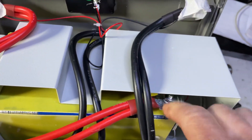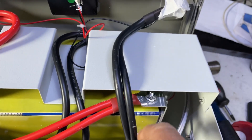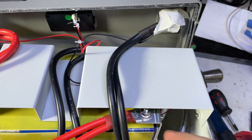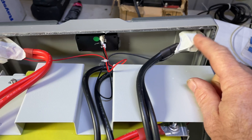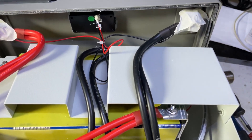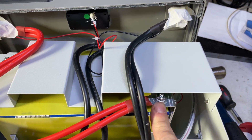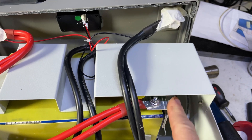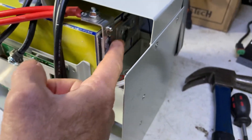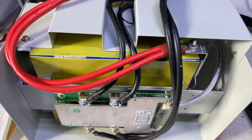The posts sit right underneath the cells, under this metal bracket, so you wouldn't want to drop it or push hard on top — it'll probably short out. Negatives are over here, positives there — that's pretty dodgy. There's masking tape used as insulation on the positive post, which is pretty rubbish. The negative cable is on a fair angle and was jammed hard against the positive battery bus bar, which is not good. They're spot welded together, which makes disassembly difficult.